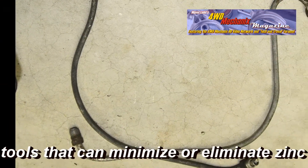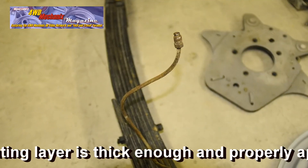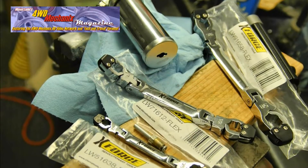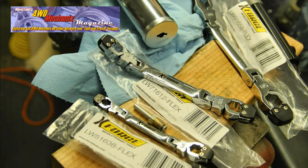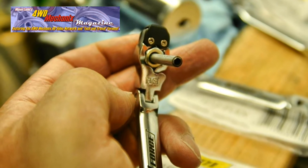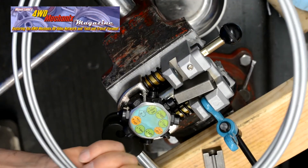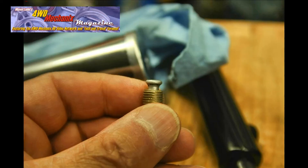Brake tubes get replaced when they look like this. In the Midwest rust belt it would be a lot worse — tubing would look more like this. Flare nuts take a pounding; tube hex flats get rounded and chewed up in the process of removing the tube. Always use a flare nut wrench. By design, this is the best flare wrench on the market: the X-Force design from AGS Company. The usual open area is replaced by a drop-in section that gives the tube nut full coverage. Flipping the wrench over provides locking coverage in both directions. Regardless of your flare tool choice, the end result should be a well-formed flare that is safe and seals properly.